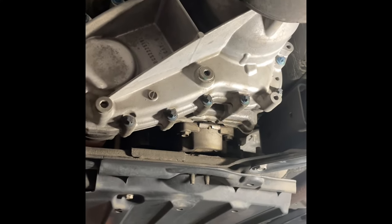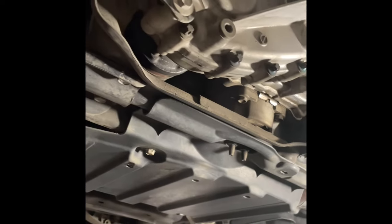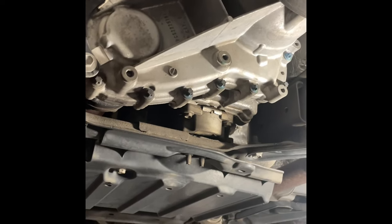I've never done this before, so I will post some updates. The plan is to get the exhaust bracket off, slide the drive shaft back, and pull the cover off to get to what we need without dropping the transfer case. Hopefully that's the case and we'll get her figured out.